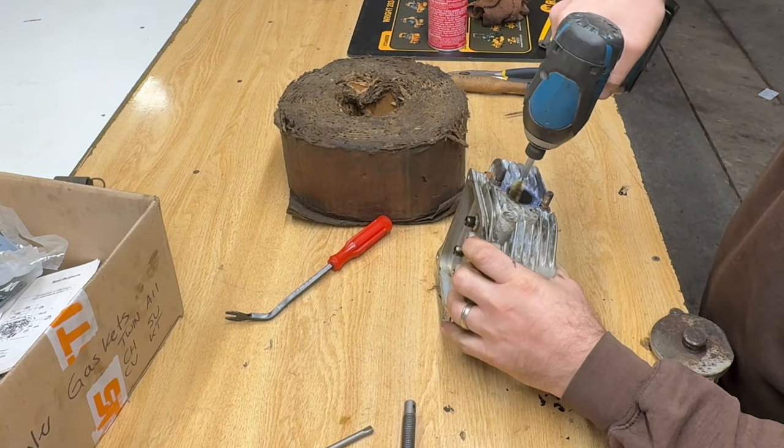Okay, before I go too much further, I should drain the oil out of this. We didn't change it. I think we just added oil in the first videos. I think it was a bit low. The drain plug on these bigger Craftsmans is in an odd spot. It's right beside the PTO clutch, just because the engine sunk into the frame a little bit. The engine mount is different than most tractors. There we go. I'm going to go in the house for a break and let this drain. We'll come back. I'll throw those head gaskets on and then the heads.